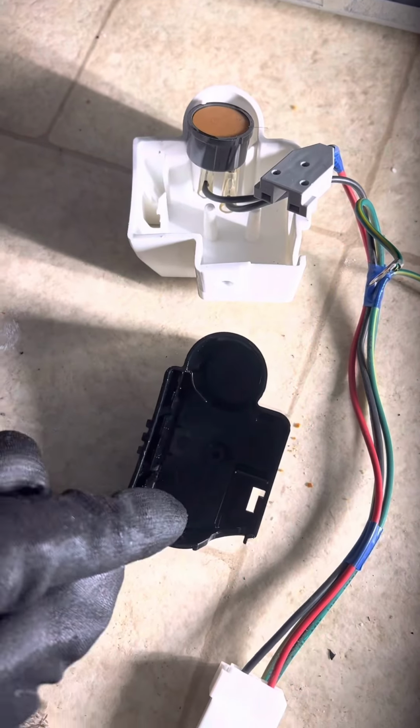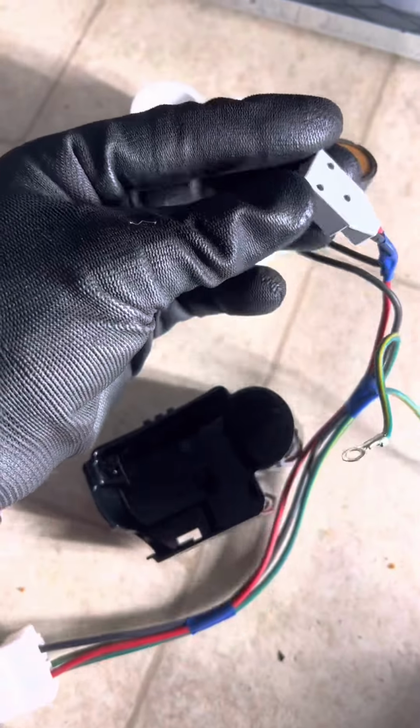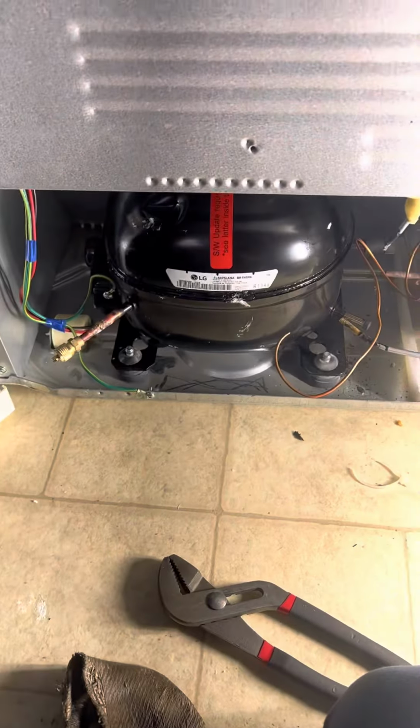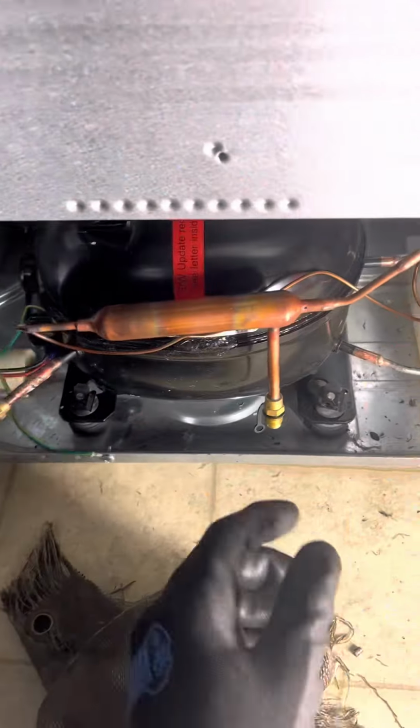All right, let's replace the old compressor with the new one. There's the old compressor. We remove the capacitor and the wiring into the new black casing, and then we have to tilt it, this plug, to get to the 3 pins of the compressor. Ground connections are both connected and the compressor wire is connected. We make sure that it's connected properly.